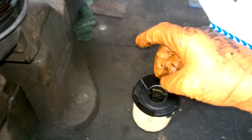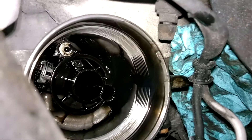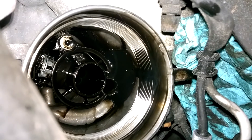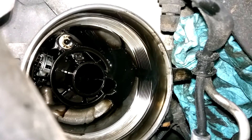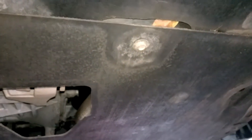I'll back that out and get access to the cartridge filter. I now have the oil filter removed — it's still in the housing here. If you look down here, there's a seal that will need to be replaced in that section. It just pulls straight back up out of position.